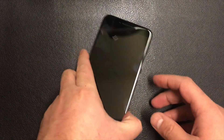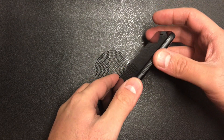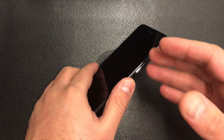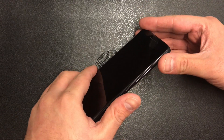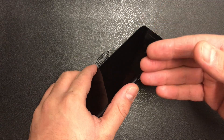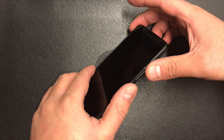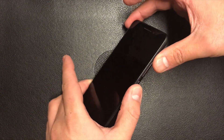To perform the factory reset on this device it's very simple. Follow the steps and you shouldn't have any issues. You'll need to hold the power and the volume up key at the same time. When the logo appears, release the power key, then press again until the no command screen comes up with the Android logo on it.